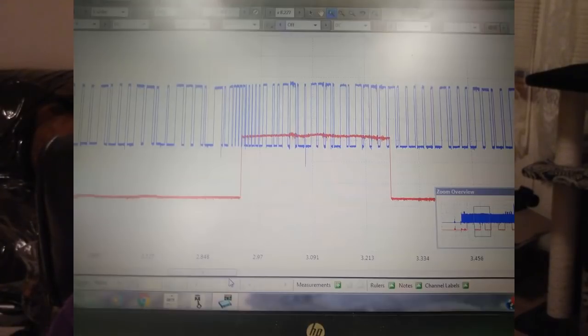That steady crank was the pattern we had on the crankshaft signal. It was not necessarily repeatable in the sense that it happened every 720 degrees at a certain point. If you had a broken reluctor or a piece broken off, that would be a repeatable pattern. This was not repeatable — it was literally all over the place and erratic.